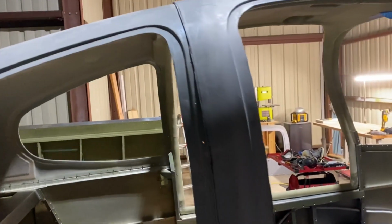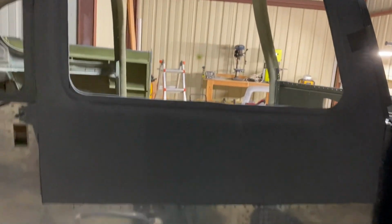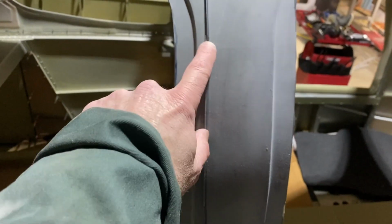I'm not sure how good you'll see this, but oops, one thing I did forget is I kept the flange on the back and I cut it off on the front by mistake. So don't do that. It just makes it easier if you can have the flanges on here so you can cleco it back on and align it and sand it down. But you know, initial cut seems to be okay. I don't see anything too glaring about it. Like I said, it's pretty rough.